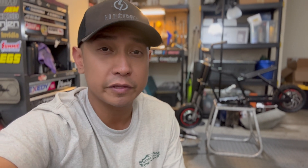On the previous video we went over the poor condition this bike was in when we initially picked it up from Craigslist. It was completely clapped out — all the plastics were bent up and the front and rear wheels were bent. So we stripped it down to bare frame, refinished the frame, and started test fitting parts like the fork, front hub motor, rear hub motor, and disc brakes. Today we're going to be working on the plastics, the seat, installing the disc brakes, flipping the tires, and going over the battery we're going to use to power the two controllers.